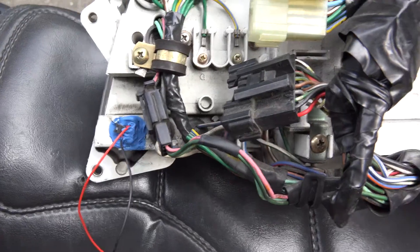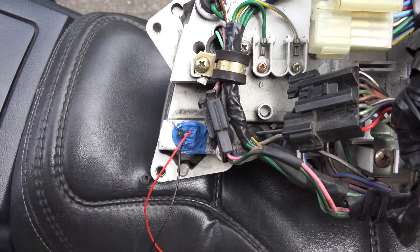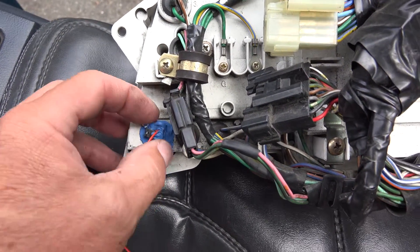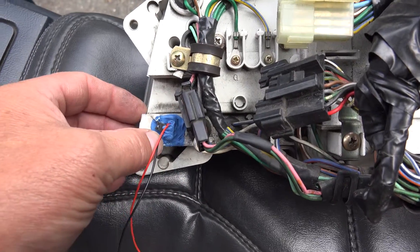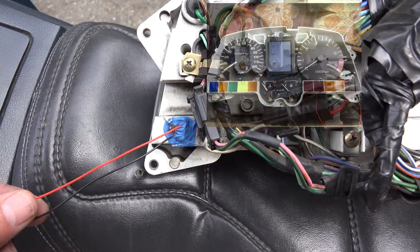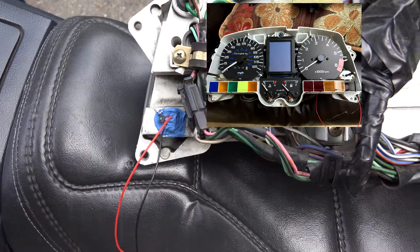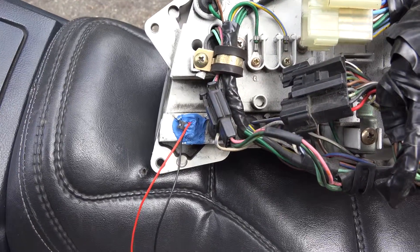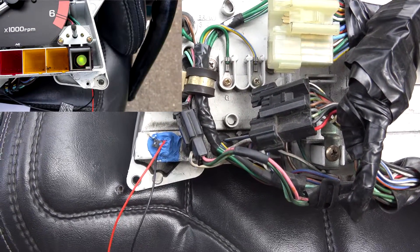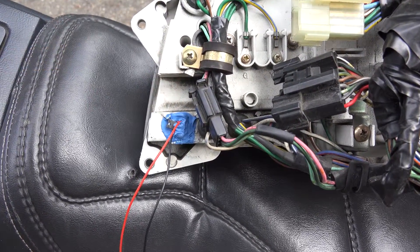On the back of the cluster, there was a blanking cap — I popped that cap out and put the new indicator in there with waterproof RTV for making gaskets, which will just last forever. I'll go ahead and just cover this jumper because I don't have any use to take it off. What the jumper does is change when the light changes colors, and my preference is with the jumper installed.